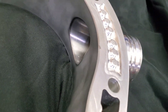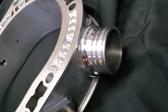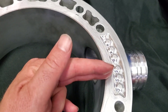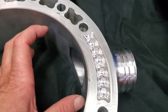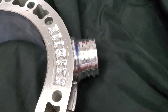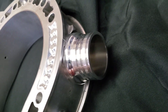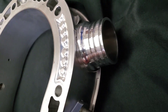The size of the hole also makes a difference. Since we're turbocharged, we wanted to bring this opening up as much as possible, and that's something Chip was able to do with his proprietary fill. That's helping us with drivability, mid-range, and air velocity. We didn't go too aggressive on the hole size — it's a little under the normal racing size — and it's done with a Wiggins clamp, so we've got great usability and it should last way longer than the typical old-school peripheral port setup.